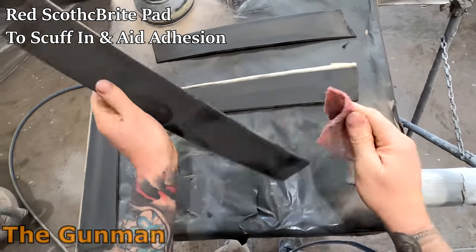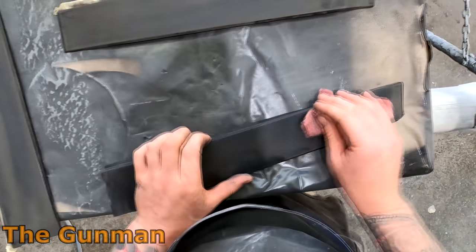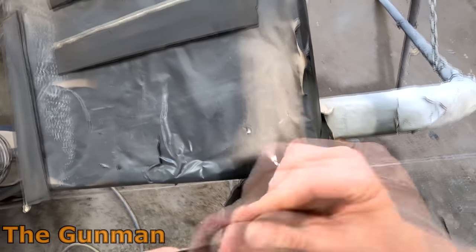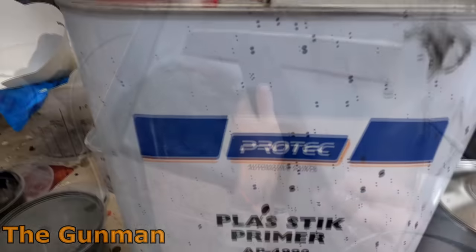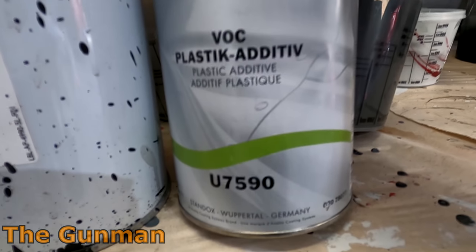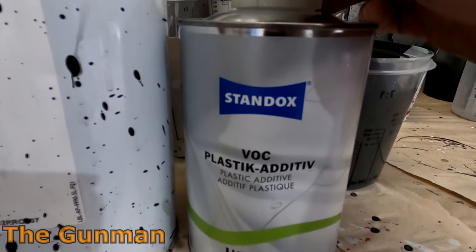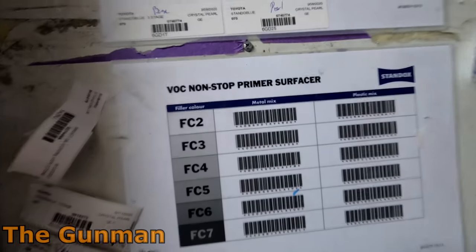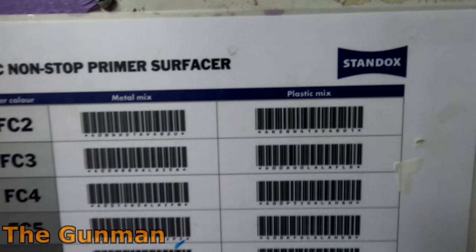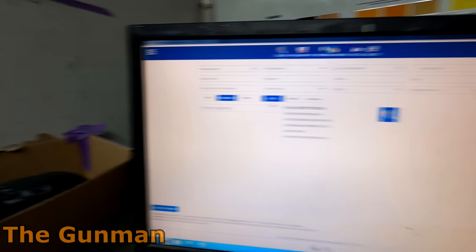This is one of those things that I probably could have sanded flat — I started off with some 320 grit and then went over the edges. I probably could have, if I really wanted to, gone through the grades, finished it off with something like 1200 grit, then plastic primed and painted straight over the top. But for what it was worth, I just wanted to put some primer on it so I'd be able to sand it back dead flat. Now here's a look at a couple of different plastic primer types: you've got your 1K plastic primer, and then you've got your two-pack one.